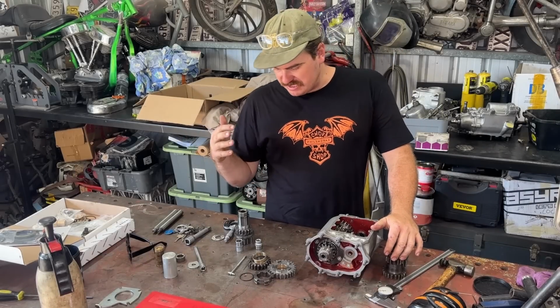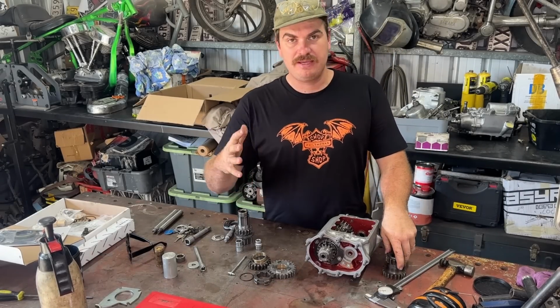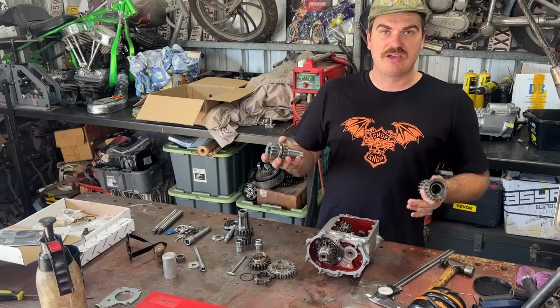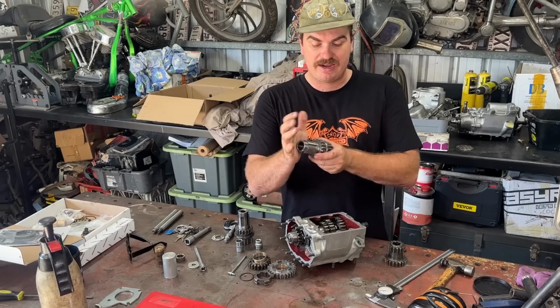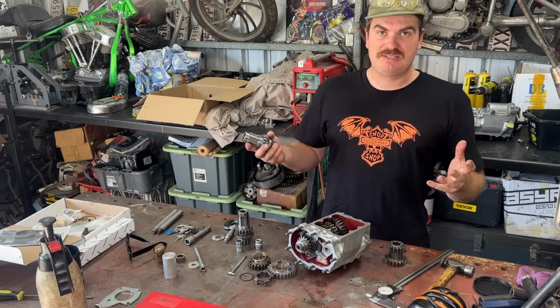Okay, I have scratched my head and I've finally worked out what was going on with this gearbox. If you look at a ratio chart, it'll tell you what ratios need to go with what, so what gear set needs to go in, for instance. I was talking about our third gear here on our main shaft not meshing with our countershaft assembly, and that is because we had some mismatched parts.